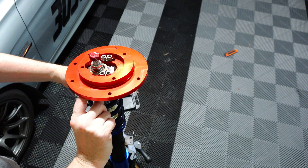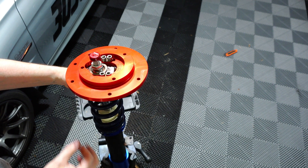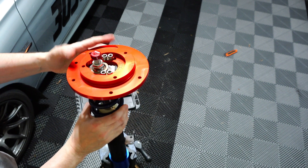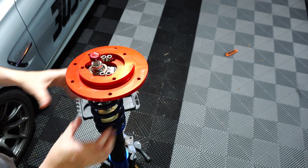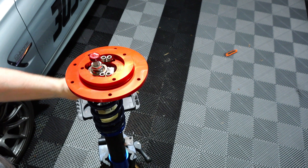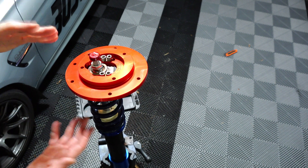You may also see some little tiny skinny springs installed on the coilover — they're called helper springs. They basically have no resistance, but they make sure that there are no clunks as the damper expands, so it just keeps it with some tension.